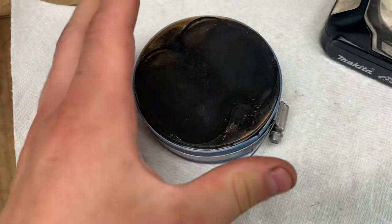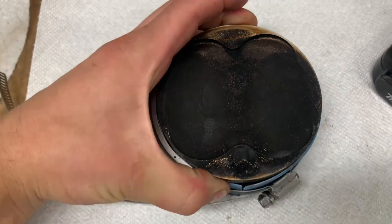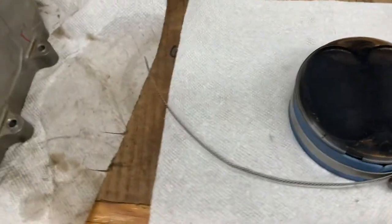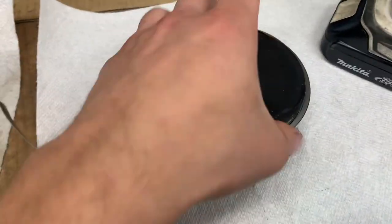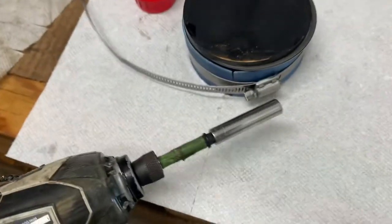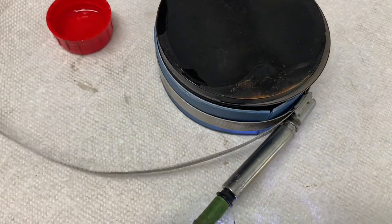Once you've got it relatively snug, you can still move it a little bit. So you're going to be in your engine bay with your motor and cylinder — start to get the cylinder on and it'll force the bin lid piece down, and the ring will pop directly right into the cylinder. Make sure you put some oil on it. What I like to do is take the cap of the oil I use for the motor, put a little oil in it, and put it on the edge of the piston — that helps it slide down. Then once the cylinder's on a little bit, have somebody else hold it — a buddy, a neighbor, a friend.